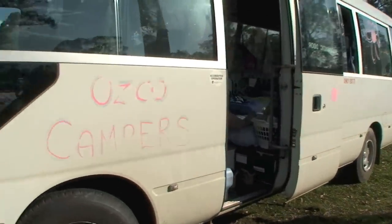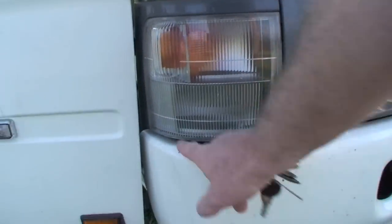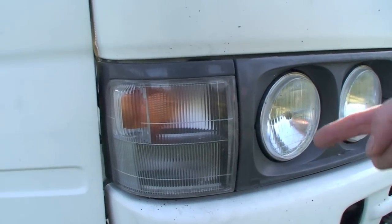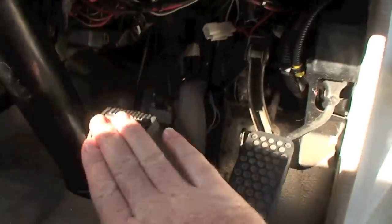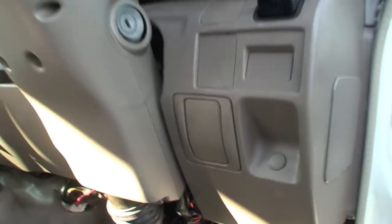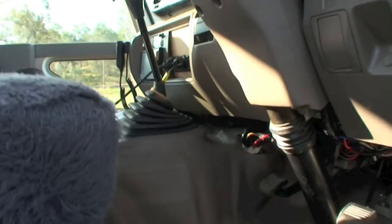It's got central door locking in the driver's side door as well, and I've got an alarm system in the car. For the driver's door, with your wiring going in there, there's a grommet at the back of the door that runs down here, goes into here. If you take off the indicator — there are two screws under there — that pops off and you've got a channel going through. Then up and under to the grommet behind the brake pedal, which goes straight through the floor — that's where you run your wires through into the dashboard and your vehicle security system.